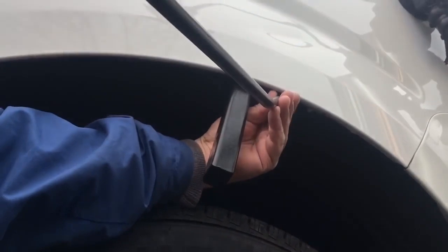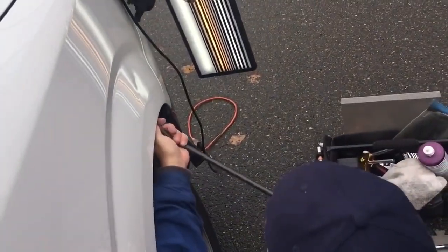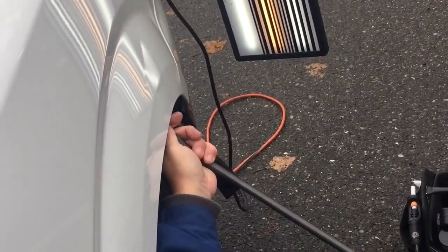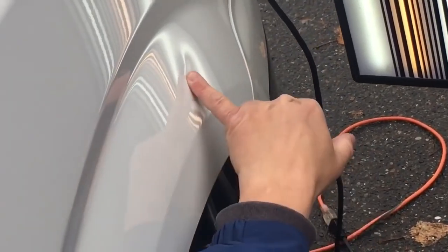I'm gonna go up here and find my spot. Now, let me move my knee pad a little, close my wax up. I might even move this to the other side right here, so I have a little bit more movement. I'm just looking for my tip. So you can see I just kind of scrubbed it along that edge, and then I see it's right there. I don't want to push in the most severe spot, but I'm going to push right about here in the middle to just kind of see how that metal is going to move. Give it a little baby push.